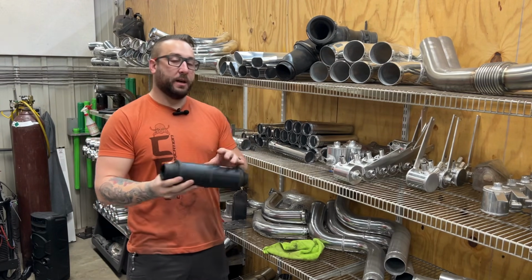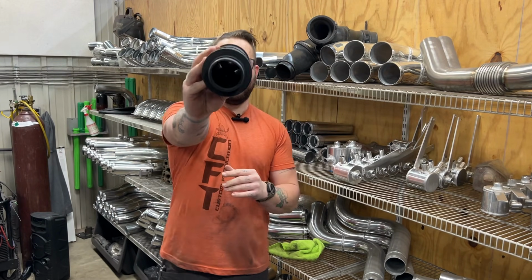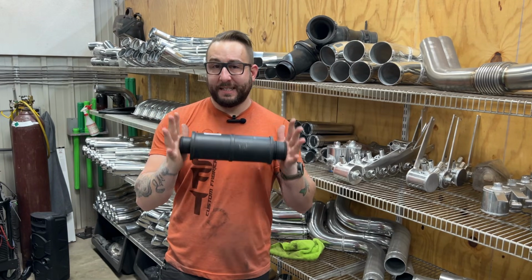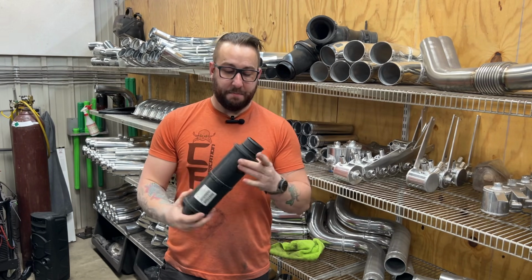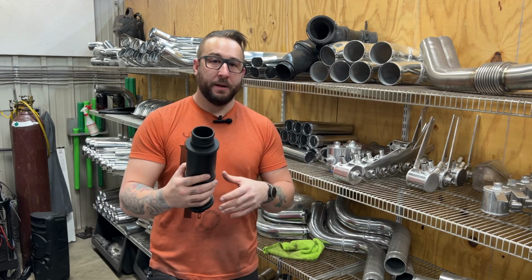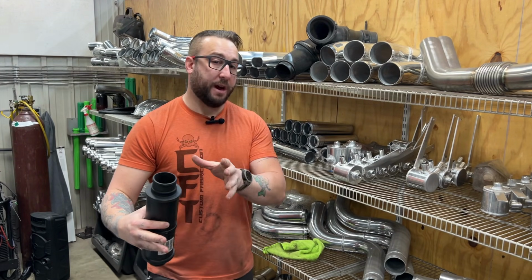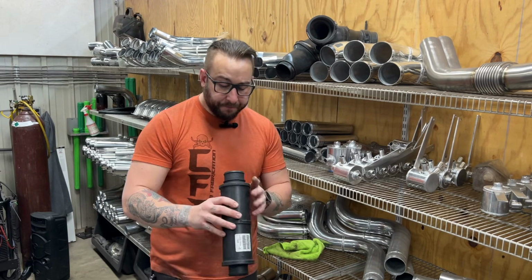Today I want to talk about the Ecodiesel, and these are the intercooler baffles. So this style is found on the 14 and 15 year model only Ecodiesels. They're a plastic designed baffle that's on your hot side pipe. If you pop open your hood, you literally look to the right hand side where the driver's side is, you'll see this mounted just like this right onto the motor.